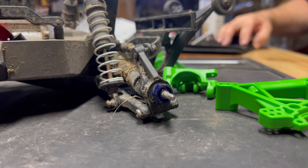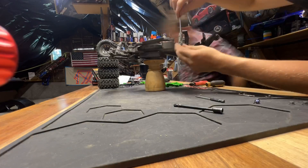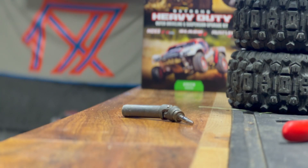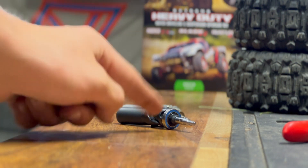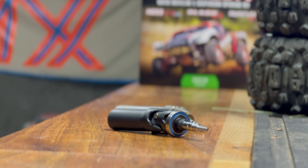Let's start disassembling all the axle carrier components and everything around it. Now that it's completely disassembled, we can see this old driveshaft — it's fine, it works — but here is the new driveshaft. Look at how much more heavy duty that looks. It has a bigger bearing and a bigger block to fit the bearing, so that's going to be really nice. That's a way bigger bearing.